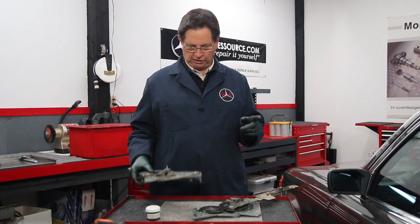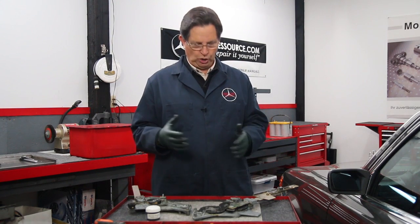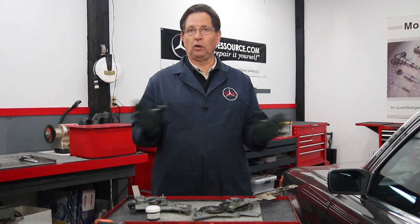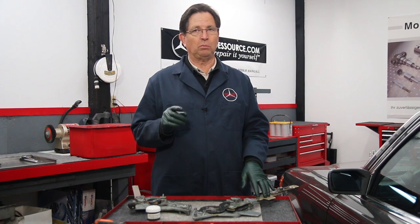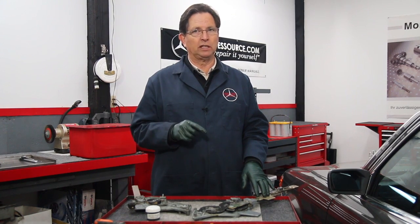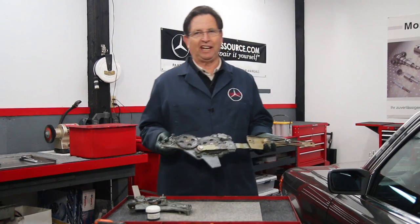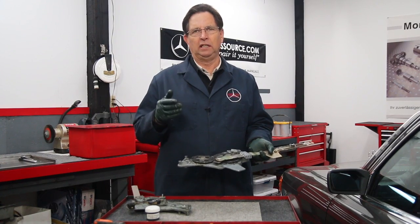One thing I do want to caution: when you do install your replacement regulator, whether it be a brand new one or a used unit. Now, at the time of the filming of this video, we're still able to get brand new driver's side regulators. I don't know how much longer that will last, but if you ever get a chance to pick up some good used ones somewhere and you own and intend to keep a W116, you might want to grab particularly the driver's regulator, because the day may come when these won't be available new any longer. This is a good used unit that I've had for quite some time. Once again, I knew that this is probably some part I should keep on hand. But in preparation, lubrication is key.